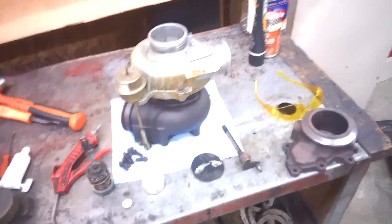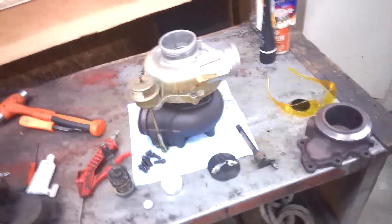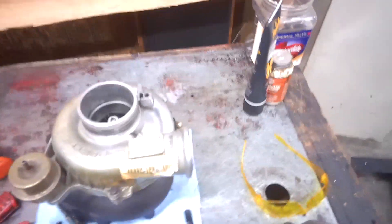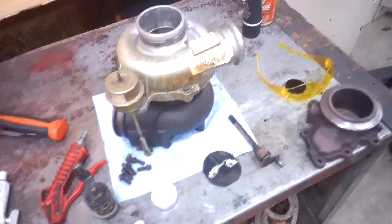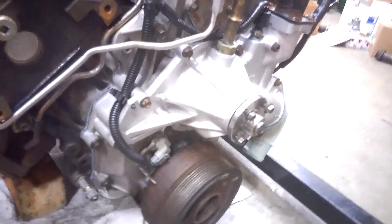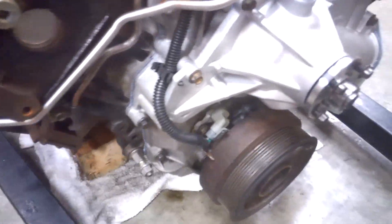Other than that, we're waiting for the turbo rebuild kit. He's going to rebuild the turbo today, get that all happy. The oil pan should be here today too and we can get that on. So since my last video, got the whole front end rebuilt, put a new water pump, got the timing chain on there. Used all of the Ford sealants that they asked to use because it doesn't make the oil foam up and all that — diesels don't like foamy oil.